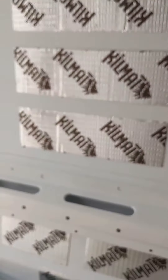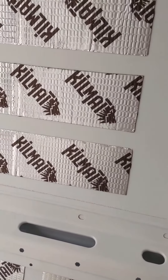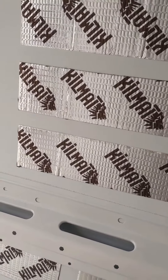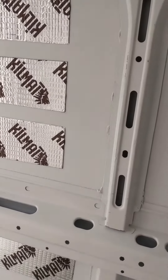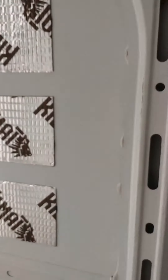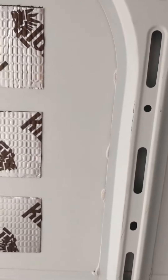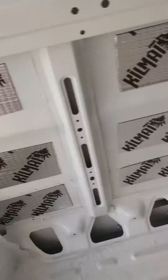Before I put the Kilmat, the van was scratched a lot, so it's important to put paint — like Rust-Oleum paint — because underneath it's going to be a little wet all the time since you're breathing, you're cooking, and you don't want moisture getting into those scratches and causing rust. All you do is take a little bit of paint and touch it up. I did that on the wheels also — look how white they are.